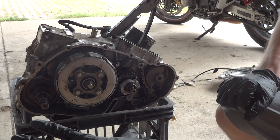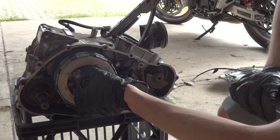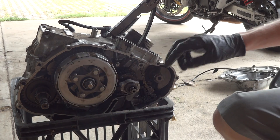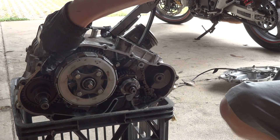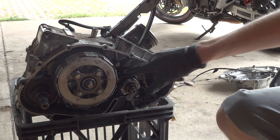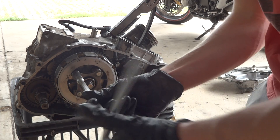This is the clutch when you have the clutch lever all the way out, so if you're driving normally, the piston moves and then all these gears move at the same speed the clutch is moving because they're all connected by this one here. So what we'll do is take the clutch off and see what difference that makes.